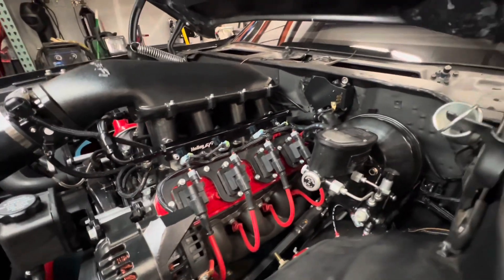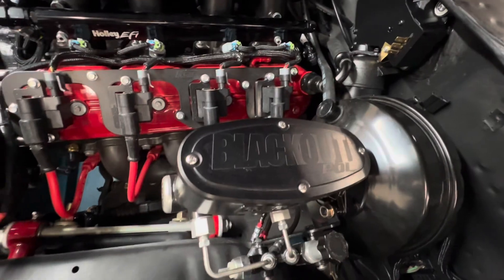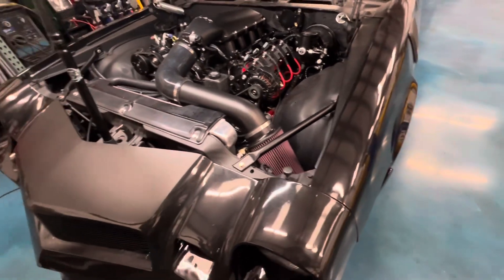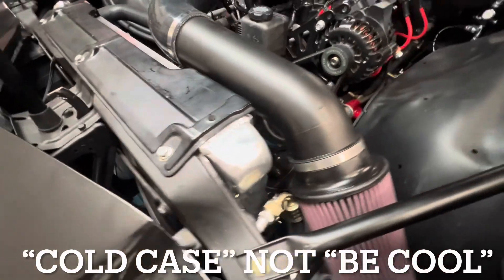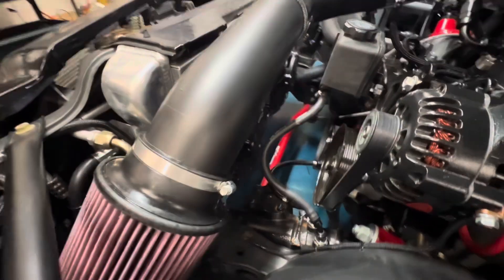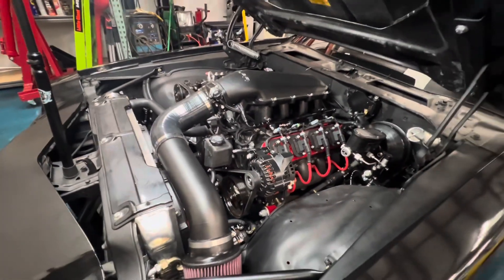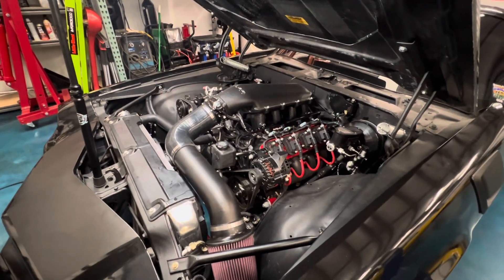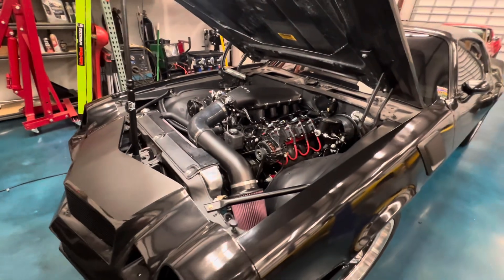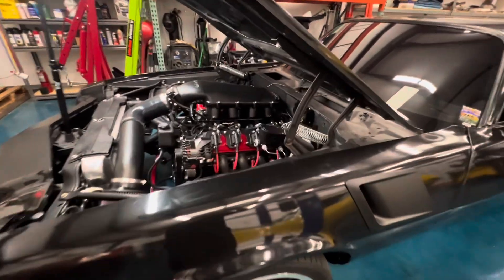The car had some pretty extensive metal work we had to do. We put brand new fenders on the car, brand new inner fenders, a brand new core support, and a B-Cool radiator. It's got the Hooker engine mounts and transmission crossmember specific for the 4L80. Really, the only thing we didn't do in the engine bay is we didn't crimp and run the AC pressure lines — we had those done professionally by an AC shop. We used Josh at Finishing Lines; he completely ran the brake lines for us and got all that mapped out. That turned out pretty good.